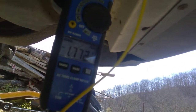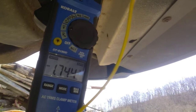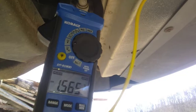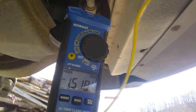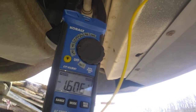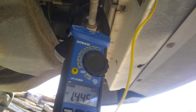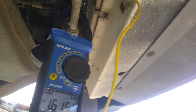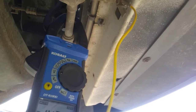Now I'm back on the T-pin and we're reading 1.7 volts. If you're reading high — like three to three and a half volts — then you can suspect you have a high pressure problem. You always want to use a refrigerant manifold gauge set to confirm, but see how the voltage is dropping now as the clutch has killed it again. As soon as that clutch engages, see how our pressure is going back up. Usually these read about 1.2 volts when they're getting power, just at standing pressure. If I had accidentally gotten on the wrong wire, this would be reading 5 volts. One should read about 1.5 volts, one should read 5 volts, then you'll have your ground reading about half a millivolt.